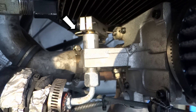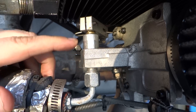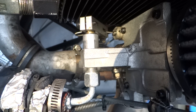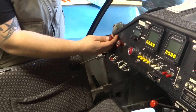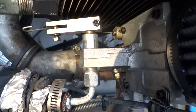Now we can take a look at our mixture control. The fuel line where our fuel comes in comes through this block. Here's the adjustment arm for the mixture control. So let's see that now. Mixture full lean. Mixture full rich. Full lean. Full rich.